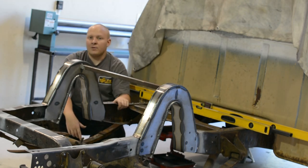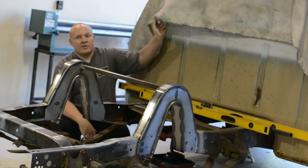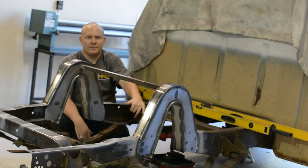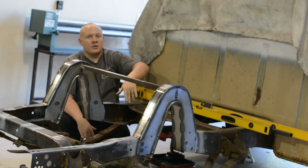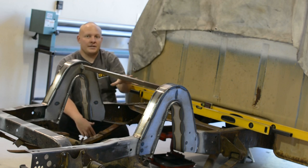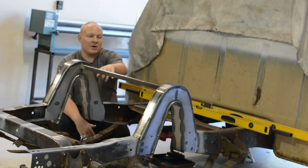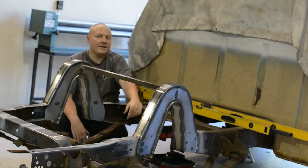I wanted to make one more note, because I think a lot of people overlook this, and that is to put some protection over your glass. Right here, we got a fiberglass blanket over the back glass. You can also get special 3M spark tape and other kinds of things. Some people just do cardboard. You will notice once you're finished doing all your work, you got your truck all nice and bagged, and you're gonna go clean it for the show, you're gonna wipe that back window, it's gonna catch your towel because all the little sparks from grinding and welding burnt into the actual glass and they're not coming out.